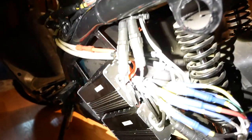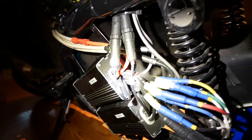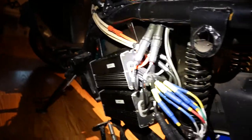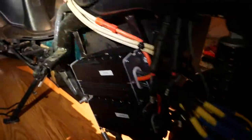All I did for the test was disconnect one of the CAN bus cables so that one of the controllers would not get the enable signal and would just stay off. Yeah, it was slower, but I could totally ride around — no problem. I can run off of half the motor, half my hardware, and still get to wherever I need to go. So that was a pretty good thing.